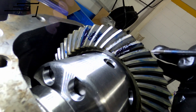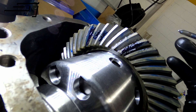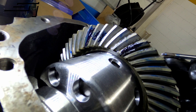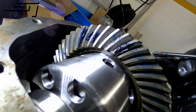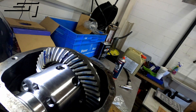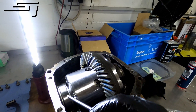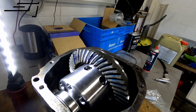If there's too much whine it means the gears are too close together. But that's why we do it — the client has warranty on it. If there's too much whining or something's not right, we'll take it apart again and redo it. But this looks good. The shims are the correct ones, so we're going to bolt it down, clean up the stub axles a little bit more, and then it should be ready to go.